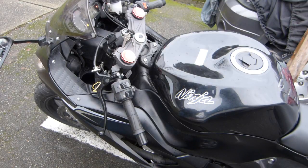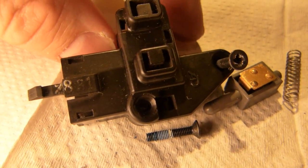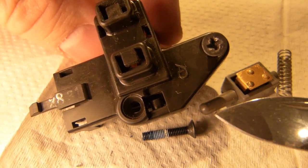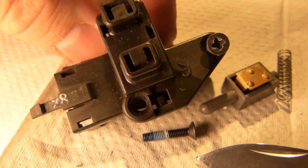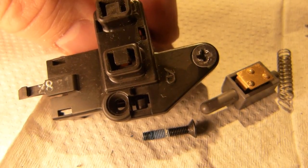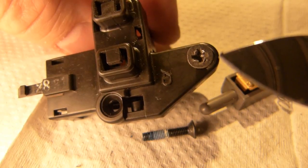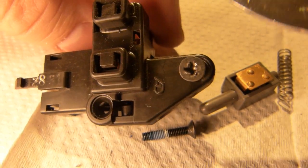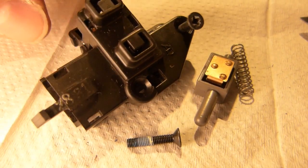Let's take a look at what's inside this clutch switch. This is how the switch looks when removed from the motorcycle — this is the underside. It mounts with two screws; there is blue thread lock applied on the screw threads so they don't fly out. Make sure you clean the slots from the screw head before you put a tool on it so you don't crater it out, making further removal impossible. The plunger and spring are out so it doesn't fly apart.